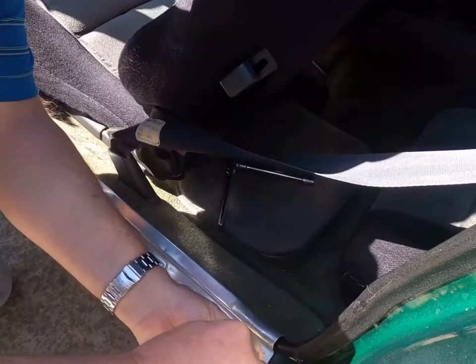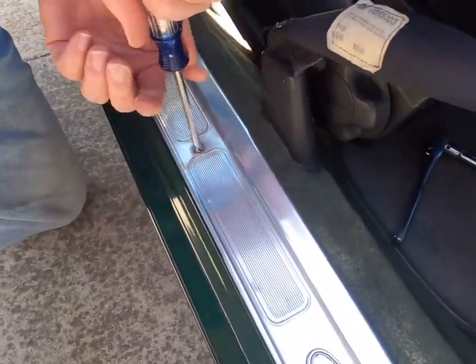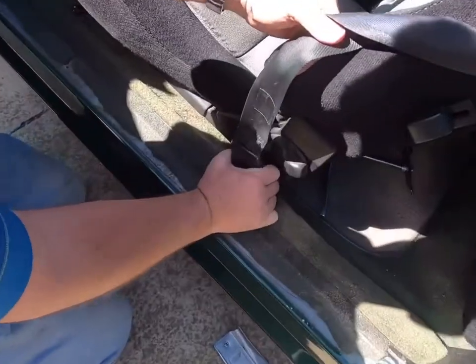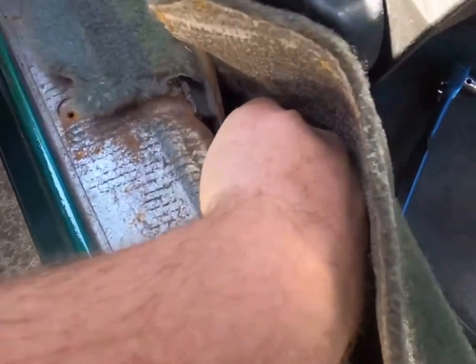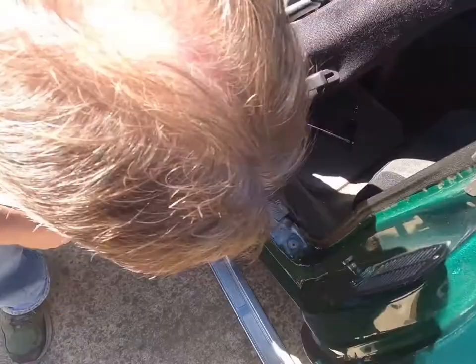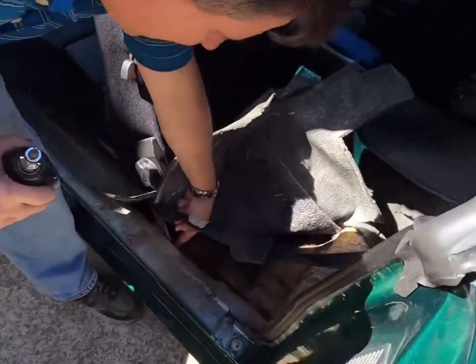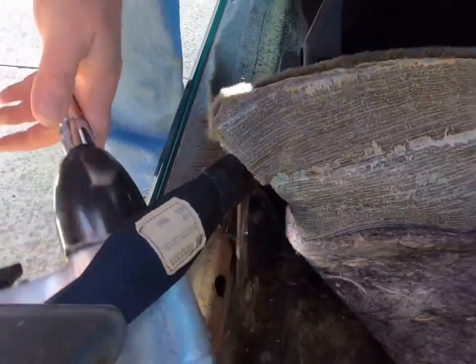First thing we're going to do is remove the sill plate so we can pull the carpet back to get to the attachment bolt for the harness right here. We'll lift the cover and peel the carpet back to get to that bolt right down in there. Once we get that loose, we'll attack the reel and get it out. This should be about a 20-minute job. We've got a T50 Torx bit because that's what that fastener takes. The seat belt's probably never been out of the car — it is locked up solid. I couldn't get it off by hand, so we had to peel the carpet back to get in here with our air tool. Maybe we'll get lucky and just back this thing out.